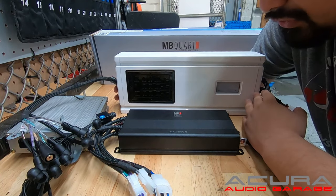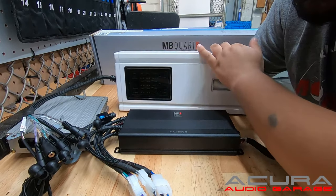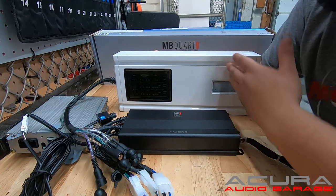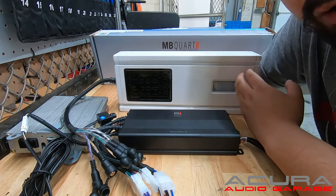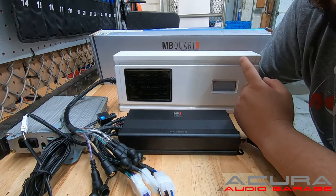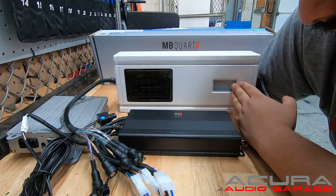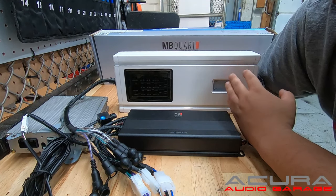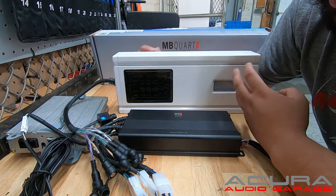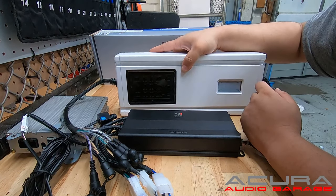This is a great option for someone who wants to change that rear subwoofer to a voice speaker and run aftermarket subs. The installation is simple and you'll get a plug-and-play harness just like the five-channel. The difference is you will have to run additional power and ground lines — a dedicated power line to your battery and a dedicated ground where you install this amp. We recommend installing this amp below the passenger seat, and all settings are preset for you depending on your selections at checkout.